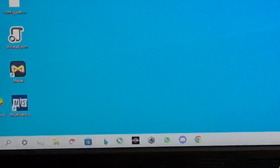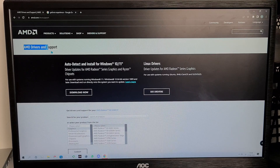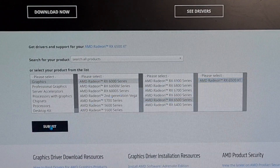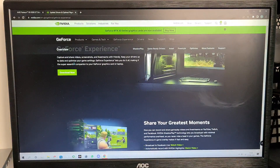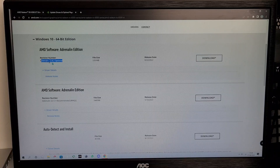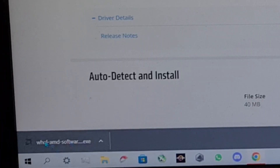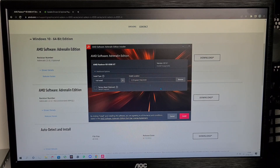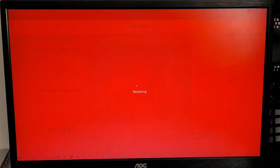Now we should restart back into normal Windows. Once we're here, the AMD software is gone — but we're not out of the woods yet. We still need to get our drivers up to date. If you're on an AMD graphics card, go to their driver support page, put in your card details — for example I'm on an RX 6500 XT — and submit, and it'll pick out the right driver for you. If you're on GeForce, you can go to GeForce Experience and download their software and it'll automatically do it for you. Both links will be in the description. Select the recommended driver — there is an optional one but the recommended is best — then download, click yes, install, and it'll walk you through a few steps. It will also flicker a bit but that's fine.